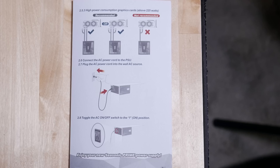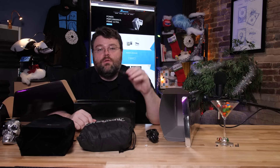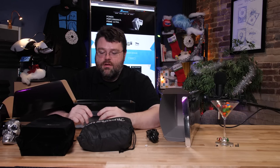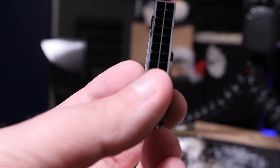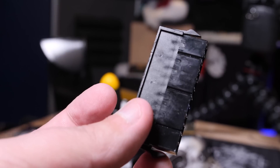It has a diagram for the correct way to wire in your graphics card. Some of the PCIe power cables are split — this is saying don't plug both ends of the split into the same graphics card; those are meant to go to different graphics cards. Also included in the bag is a dummy plug, which appears to be wired to turn the power supply on all the time — there's a wire on the motherboard connector that always turns the power supply on. That might be useful for a mining rig.